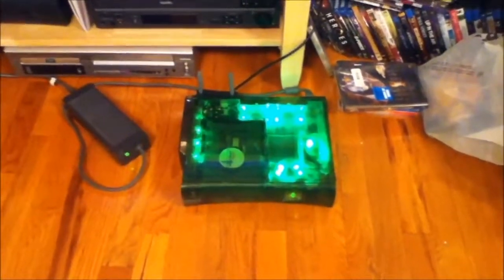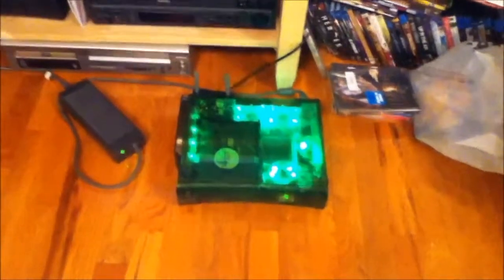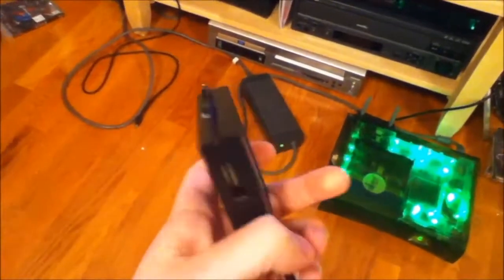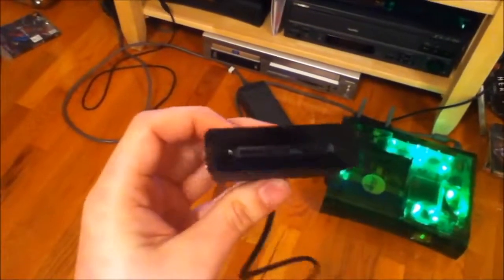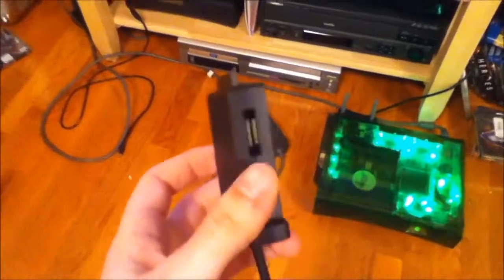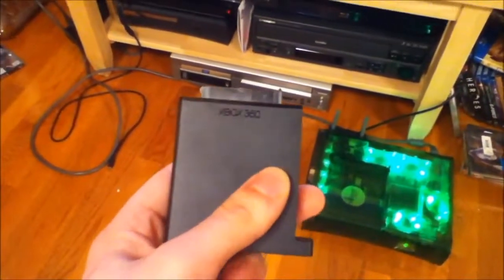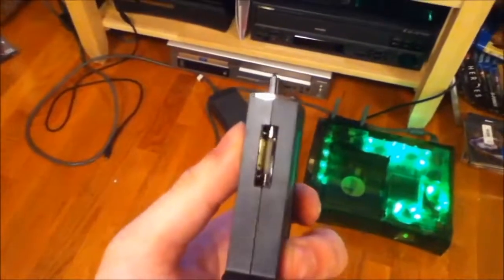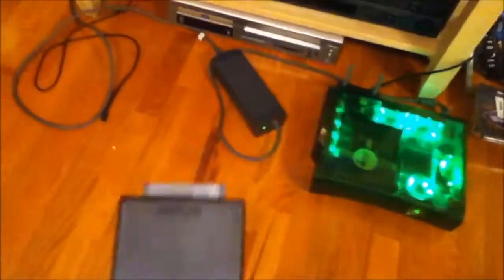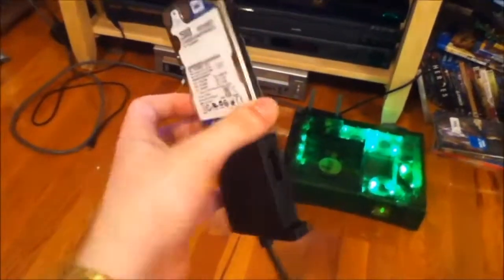Now I will show you how to take your old hard drive and the sync cable and put your files back on your Xbox's new drive. To start this process, you must have the new sync cable — the one with the SATA tips, which are for the slim drives but will also work on your old drive without a case on it. Or if you have another case laying around, you can use the other transfer cable if it's an original case, but most people will not have that. So this is how you do it: plug these tips into this hole. Once the drive is plugged in, it should look like this.